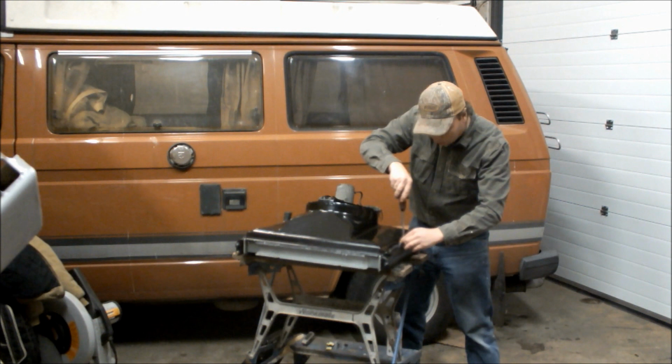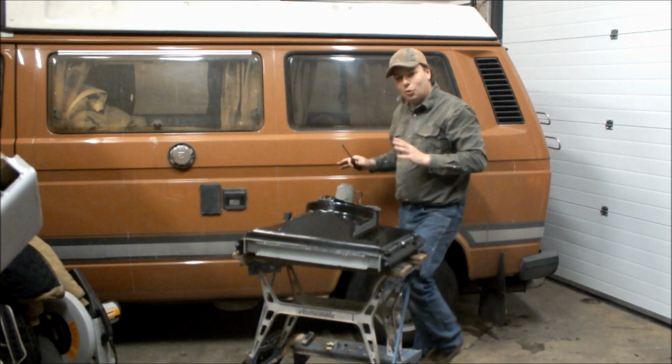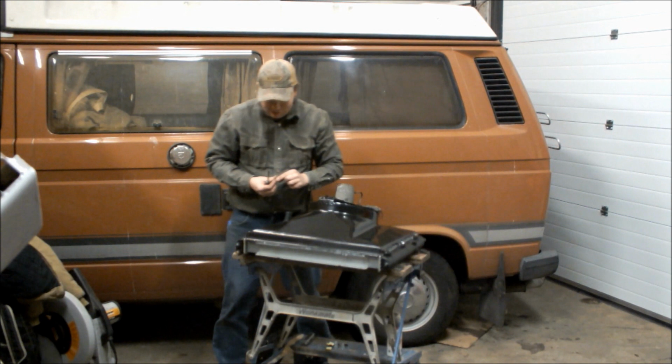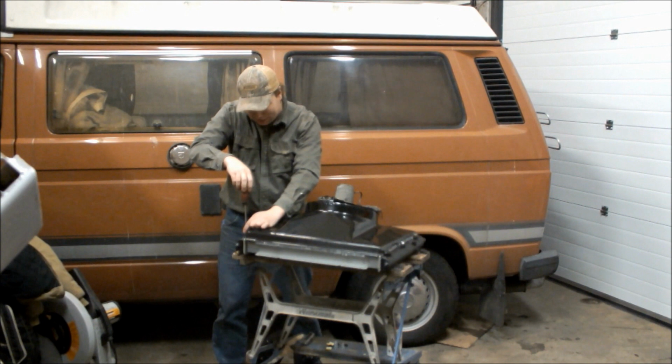And this one, what I'm going to do at the back, just to make sure that, with the radiator at the front and all these nice little mods working, if the water's not getting out of the engine up front, it's a long way for it to be pushed. Now, you can buy water accelerator pumps. They're quite expensive, actually, but I found out by just digging around on the internet a little bit that you can use one from, I think, the Audi A4 with a diesel. They fit one, or no, it's turbo petrol. They fit one standard. And that's what I've got.